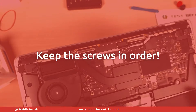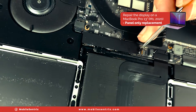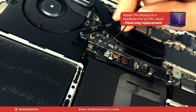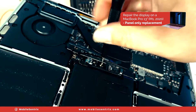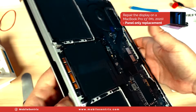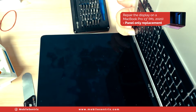Keeping all the screws in order so we can put them back in the same spot. Before we do that, I'm going to grab this sticker here and lift it up so we can disconnect that ZIF connector and pull out this flex. We'll grab our screwdriver and take out this screw, then lift up this tab. Now we'll open it back up and hold down the power button for about five to ten seconds to give the motherboard a proper drain of all residual power.